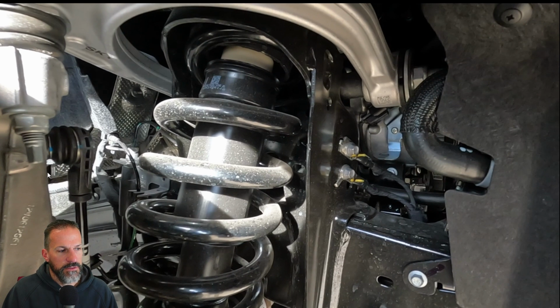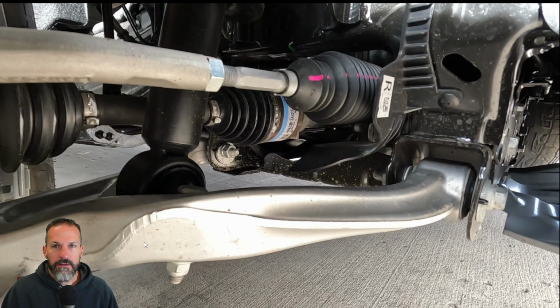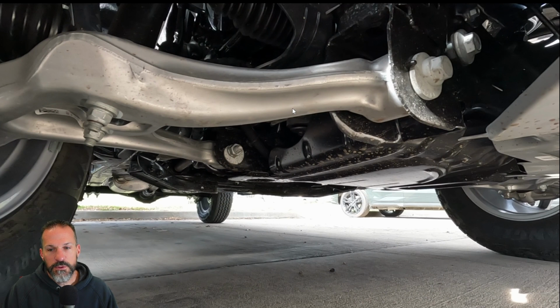Control arm's aluminum, and this big casting over here for the knuckle is aluminum as well. When you have aluminum arms, aluminum knuckles and everything together with then a steel bearing, and you get 150,000 miles, sometimes those differing metals will fuse together, like welded together, by the time you have to replace that wheel bearing. That doesn't look super big, the casting on it for a truck. I mean, I see castings like this size on my son's Volkswagen Jetta, so aluminum's got to be a little bit bigger cast to be as strong as steel.